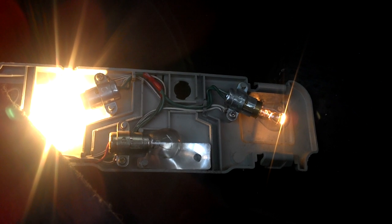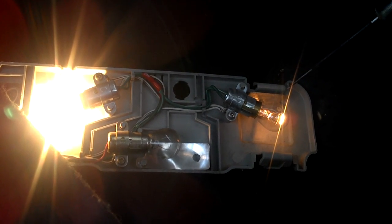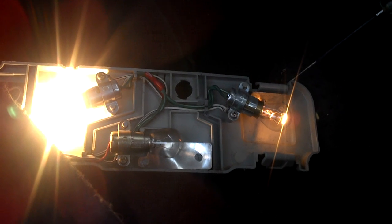I'm trying to do a quick voltage drop test — great example here. These are brake lights. The brake light on the right side is dim, and actually when you have the headlights on, this light will go out.